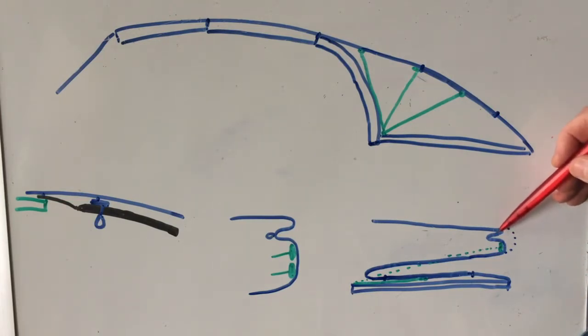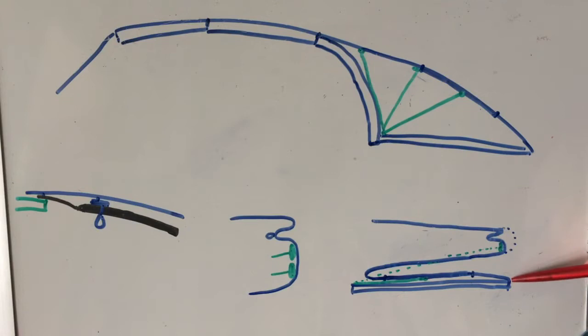At the back here, because that compartment where it goes down to is actually going to come down about here, this bit bulges out, and it's just loose cloth. And so what it needs to do is actually needs to be pulled in and tucked in so it doesn't actually interfere with the boot lid. And that is where the problem occurs, where this actually gets stuck out a little bit and then starts to rub on the boot lid and create damage to the actual canvas, which is no good.